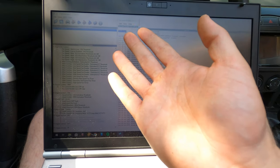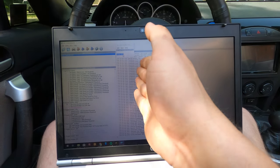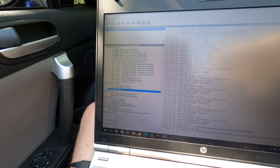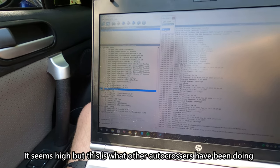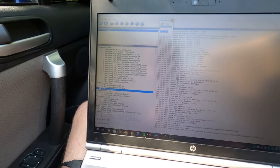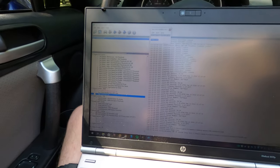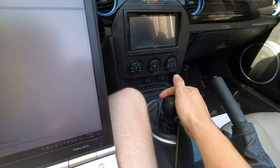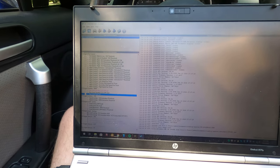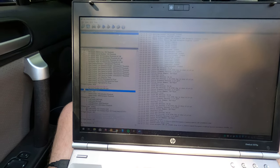So it's actually got two different kinds of rev limiters. There's the throttle blade itself starts backing out, and then there's the actual spark cut. So what did I make my fuel cut? Or sorry, fuel cut. I made the fuel cut one 7,400. Let's change that to 7,500. And then we'll make the throttle cut out at 7,400. That isn't necessarily to make more power. These engines' power drops off a cliff. That's because in autocross, in second gear, I might want that extra 5 miles an hour. I know the last autocross you saw, I was heading across the finish line going ring ding ding ding ding ding ding ding off of the rev limiter.